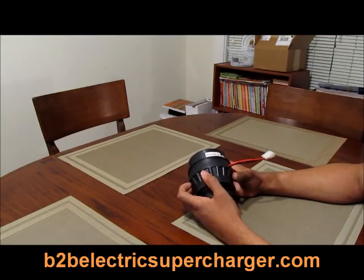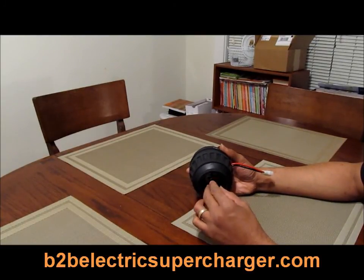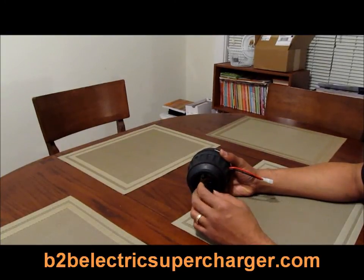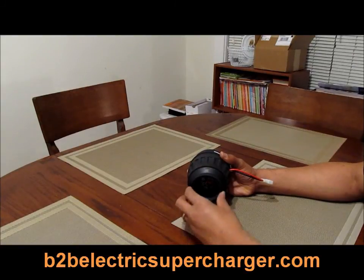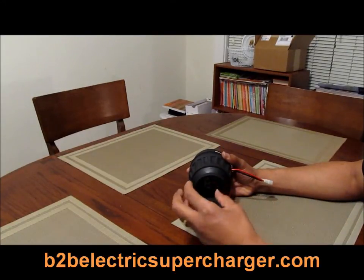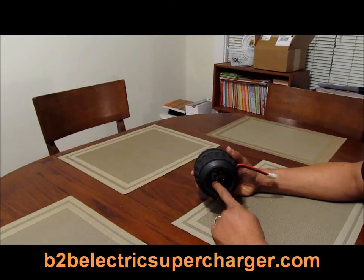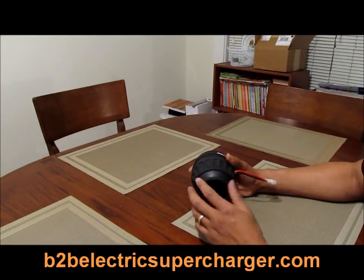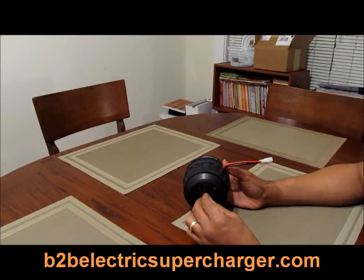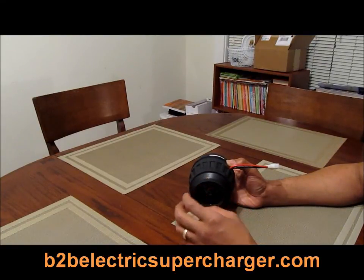What will the seller tell you once you bust him out on the boost? He's going to say, 'Well, when this flows, it's going to flow 1200 CFM into your engine.' Here's the thing — it might flow 1200 CFM, but it's not going to flow 1200 CFM in a confined, constricted space like a manifold or your intake. It might flow 1200 CFM holding it in my hand, but when you attach it to an engine, flow is significantly reduced because this little 12 volt motor is now placed under a load.